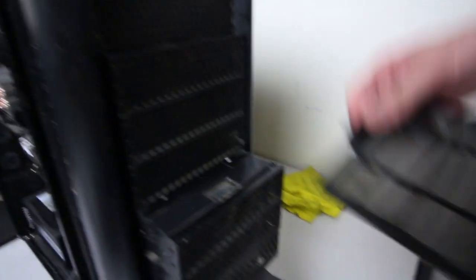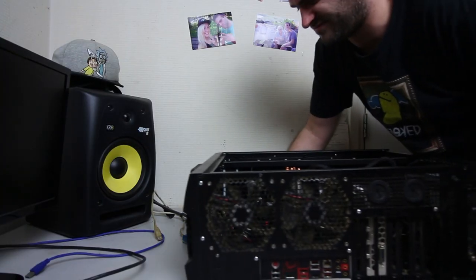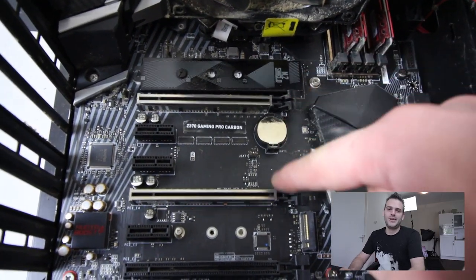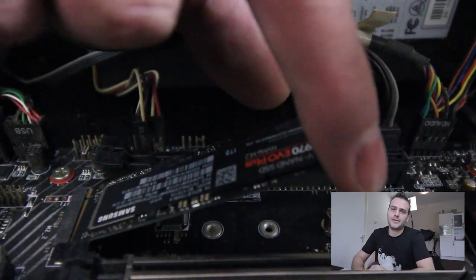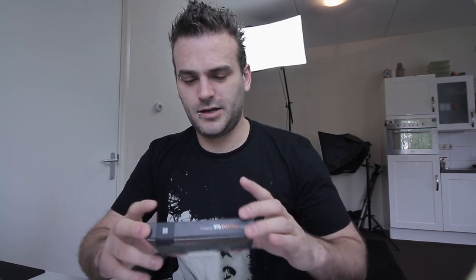Did you see the dust inside my PC? That is not good. Now let's check out how to assemble this. I have two M.2 sockets in my motherboard — one has the M.2 shield and one does not. I'm placing it in one of the two locations. As you can see, it's very easy to install — you just click it in. This is a dot-M2 SSD card, which means it needs a motherboard with the right M.2 socket. Then you just screw it down — very simple.